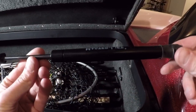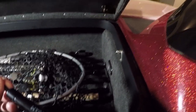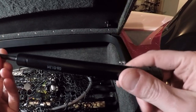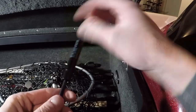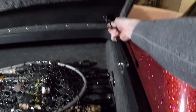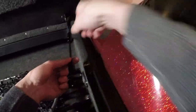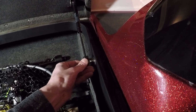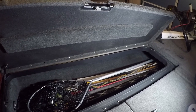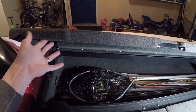The really cool thing about installing new struts onto the mounts you already have — one on the end of the rod box, one up on top — is that you don't have to mess with the clips at all to put these back on, they just pop straight on. All you literally have to do is take this guy here, push it straight onto the ball, come down to the other one, turn the head if needed, lift up a little bit, push it back on, and you're done.